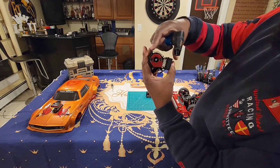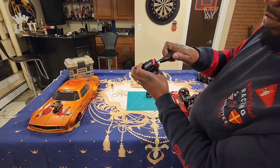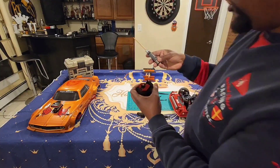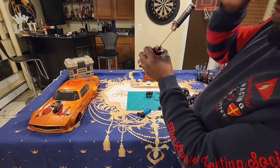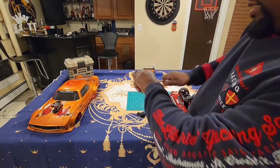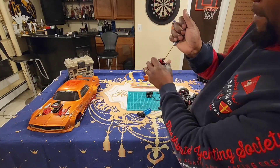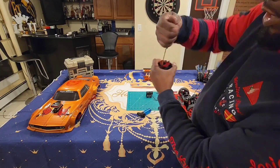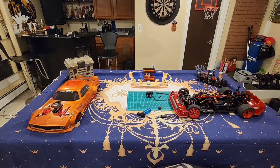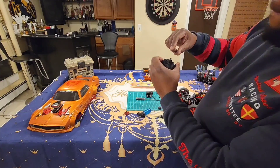Now take your lighter one more time. You've got two screws here, one on both sides — gotta get those two out. Take your lighter and heat those two up, give it a little heat. This one requires the 2.5 millimeter — get it all the way inside there. You hear that little click and she is out of there. It's in there pretty tight. Get the other side — there we go. When you heat it up, it doesn't melt everything inside there, it just heats it up enough and it'll pop off.